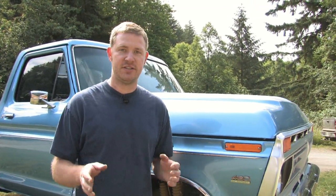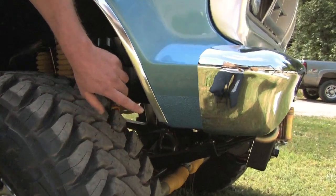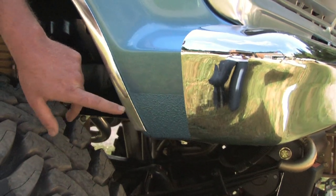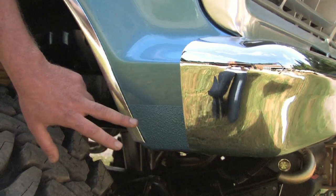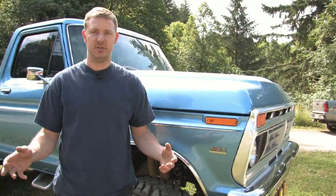One thing that's very subtle but makes a big difference in appearance is by adding things underneath the paint or integrating different textures into the paint. Since this is a big off-road four-wheel drive truck, we implemented what's called rocker guard, painted the same color as the rest of the truck. We broke it with a tape line, sprayed it on, and then painted over it. This adds lower protection from rock chips and gives the truck a heavier duty look without standing out — if it were black, it would stand out. Simple things like that can make your paint job look very custom.